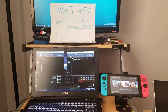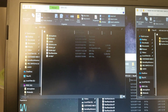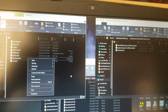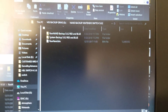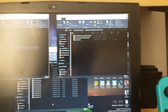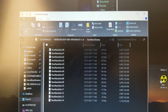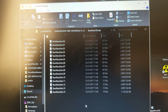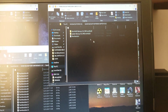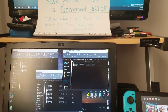Now that I've put my micro SD card into the computer, I have taken the 'rawnand.bin' file, copied it, and pasted it onto my computer as a backup. If your SD card is smaller, your raw NAND may be backed up in portions that can be compiled together using a tool. Otherwise, you'll end up with a single raw NAND file. Copy and paste it onto your computer, then delete the original from your micro SD card. Like, subscribe, and share — this is very important. Take care.